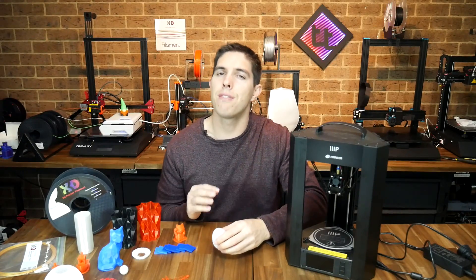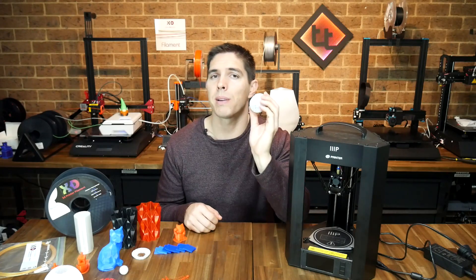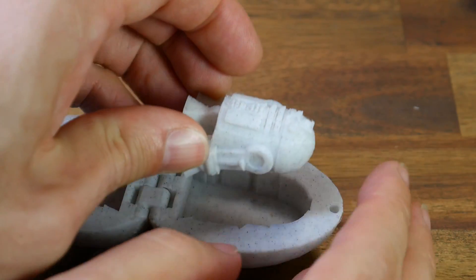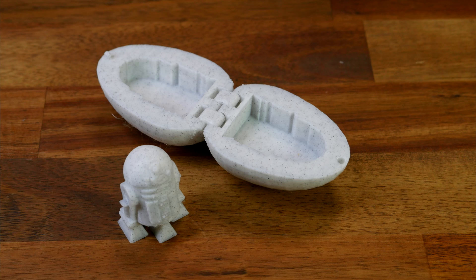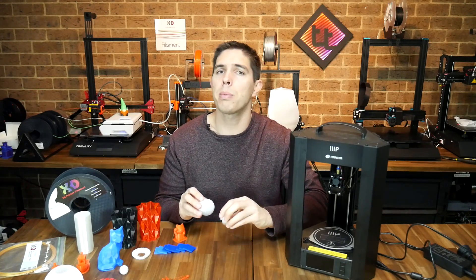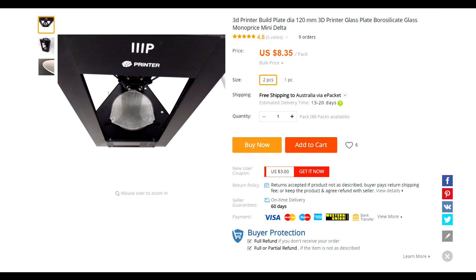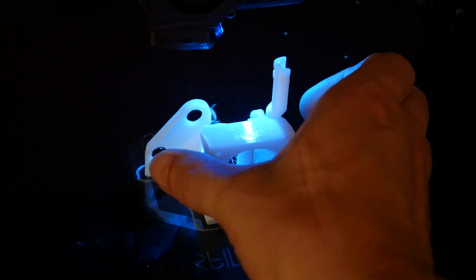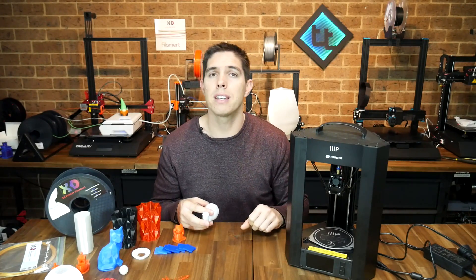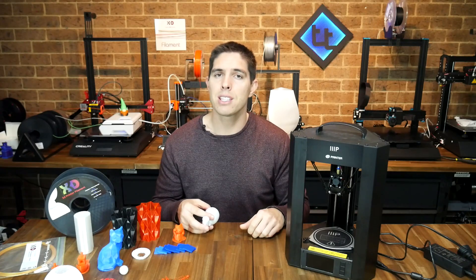My final thoughts: this printer is very very good at what it does well — extremely nice PLA prints, fast, accurate and reliable. As an example, I've got this little Easter egg with a really nice fit, and inside is a perfect little R2D2 that nests really accurately. The egg was printed in place so the tolerances are spot on. It might be limited for more exotic materials, but this thing is going to be excellent for kids, schools or people who are new to the hobby. The main issue is removing prints, but aftermarket glass beds for this printer mean it will self-release once it cools. If you're looking for a bargain to get into 3D printing and you can handle the small build volume, this one definitely won't let you down. Please leave your thoughts in the comments below — thank you for watching and until next time, happy 3D printing.